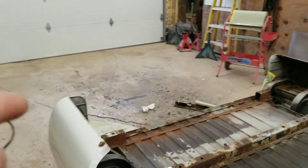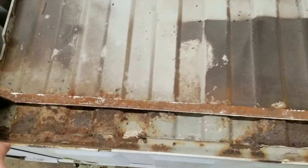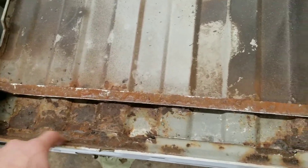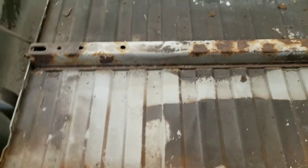We're going to go ahead and repair all of his busted stuff here on his bed and kind of strengthen this thing up a little bit. I think what I'm going to do is just cut a whole new lip for this side, put it in, then go back and put the box in like I was talking about originally. That way I'm not messing with just cutting out little pieces — I'll cut a whole new one, weld it in place, and proceed on.